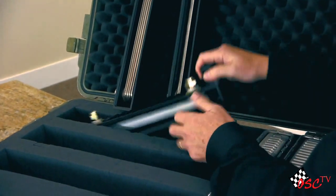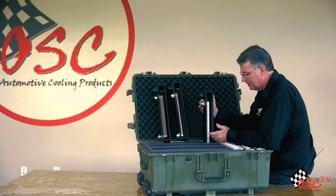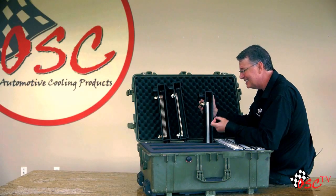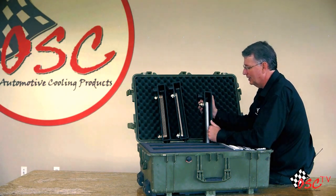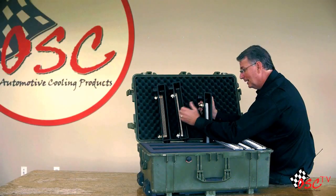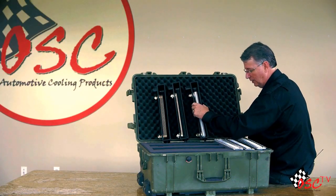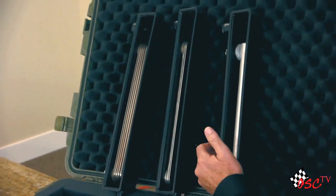On the economy brand, you're going to notice that they went to an aluminum concentric cooler inside there. The aluminum concentric cooler, depending on the size, is about one to one-and-a-half plates worth of the stainless steel equivalent. So it's even less — it's not the four plate, it's not a two plate, it's probably a plate and a half worth of cooling. So: original four plate, two plate, one plate.